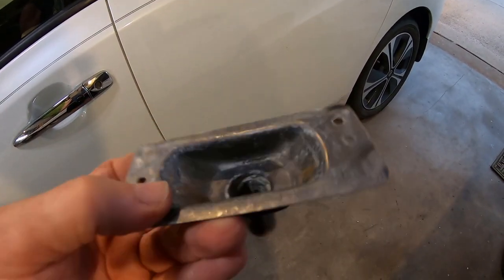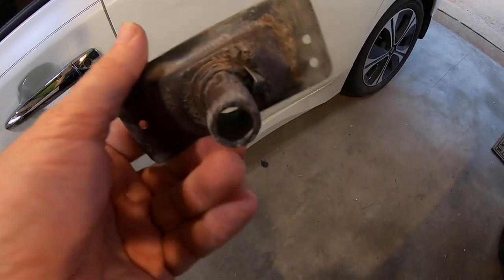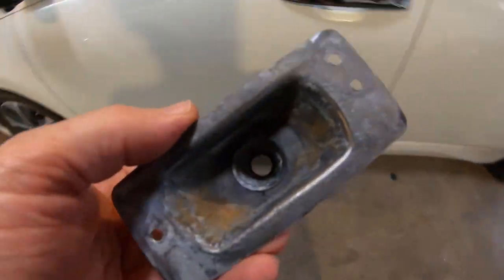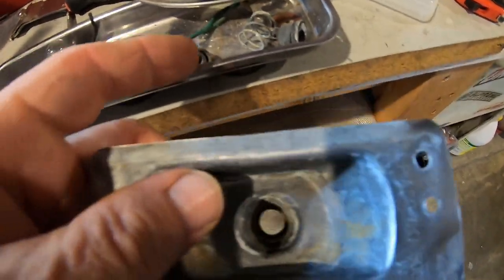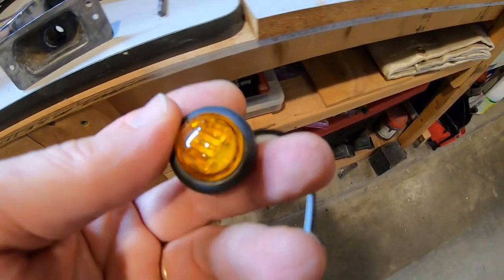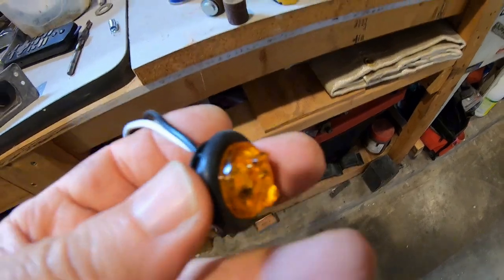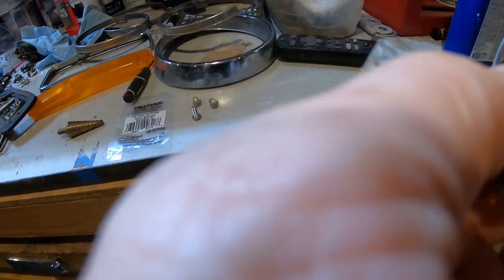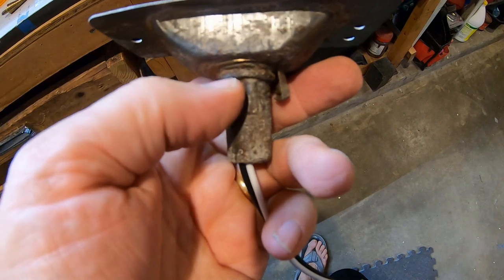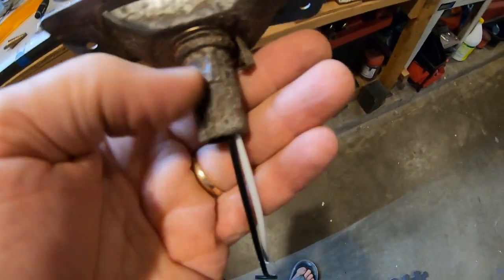I used phosphoric acid — lots of coats and time. I didn't wire wheel the inside, it's too hard to get in there. I've got a crazy idea: instead of putting back the wire, spring, rubber, and bulb, I'm going to use trailer lights. A three-quarter-inch hole — I got these on my trailer for about five bucks. They're completely solid state and sealed. They actually fit perfectly in here, about the exact same size. I could cut off the old spring and cup and bulb, and just pop these LEDs in and put the lens on top.